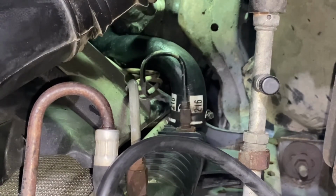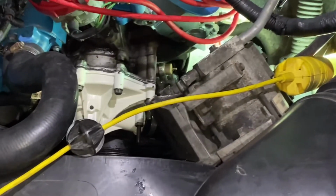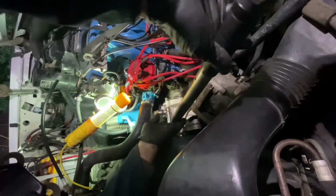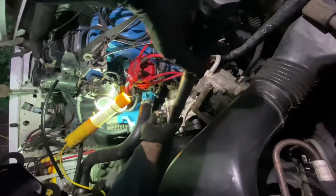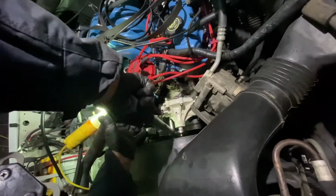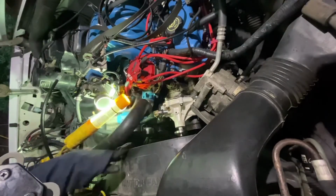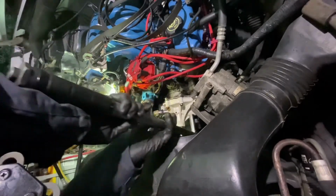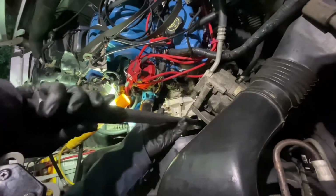So the next step is we'll wait a little while longer. We'll torque all this stuff down here, and then tomorrow I will put the coolant back in there. And so now we'll torque this to 20. And then tomorrow morning, I'll come back out here and I'm going to double check this torque again before I go any further. Because sometimes you wait a while, things kind of relax with gaskets and stuff.